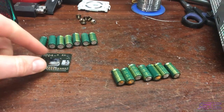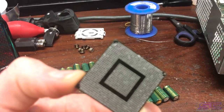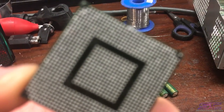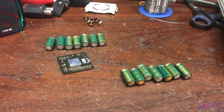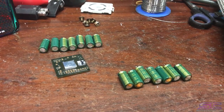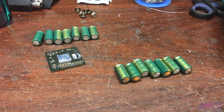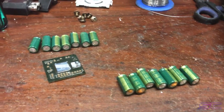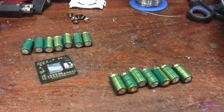But as long as you follow the video like I do, you shouldn't have this problem. This is a freak thing to happen, because I never have the solder balls bridge or anything. That was just a really weird thing to happen. But anyway, guys, I hope you learned from this video, and I hope you use your knowledge to do more consoles and improve, and I hope you have great success doing this. The reflow process will work for you. You just have to get the temperatures right and everything set up correctly. It's going to take a few tries, probably.